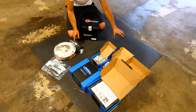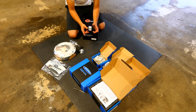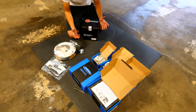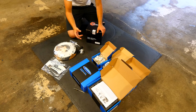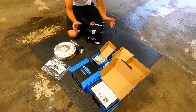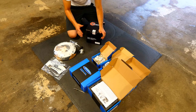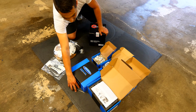So we can power the driver's side and the passenger side at the same time. Now, technically, the differential that I have inside my transmission is an open differential, and that isn't exactly ideal, especially when you're making big power. There is what's called an electronic differential, where the brakes and the transmission and the wheel speed sensor will all take information, and it'll try and pulse the brakes and modulate it, so it'll act like you have an LSD when you don't. However, I'm going to be opening up my transmission and replacing the pumpkin with this one here.